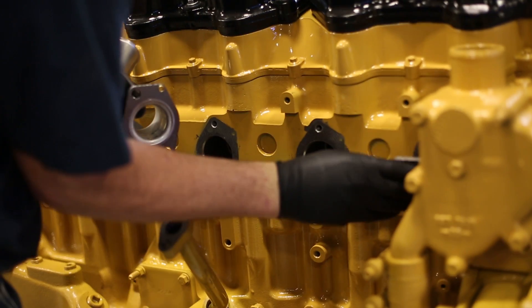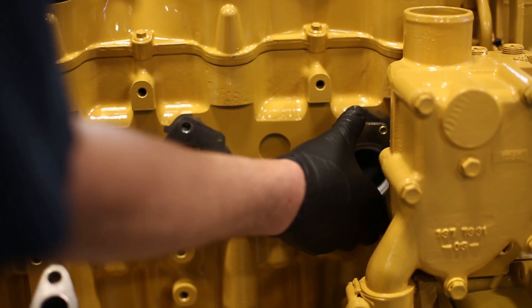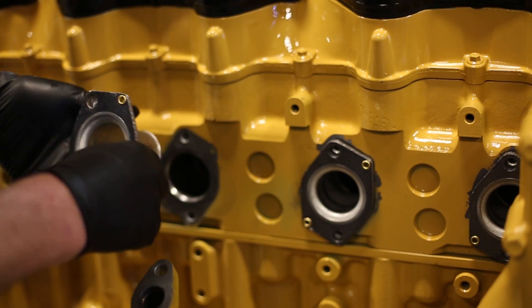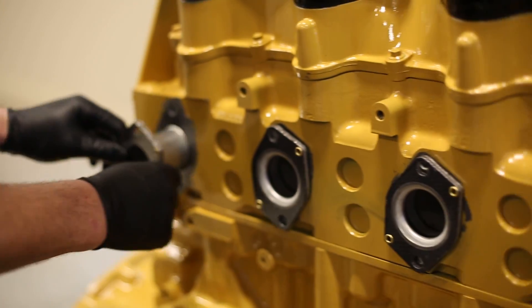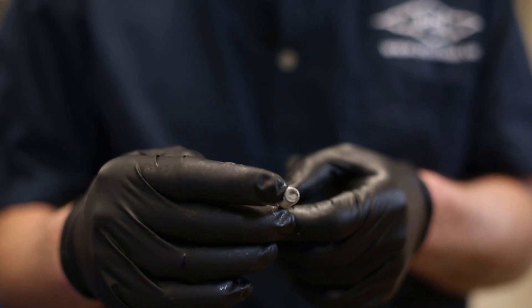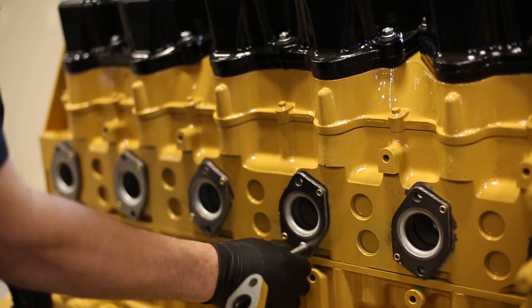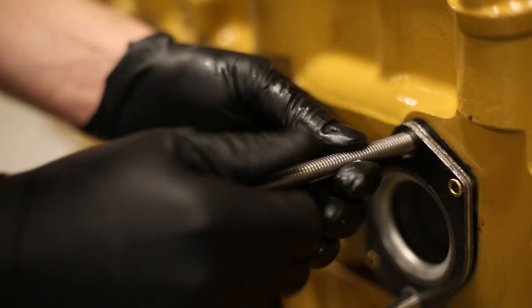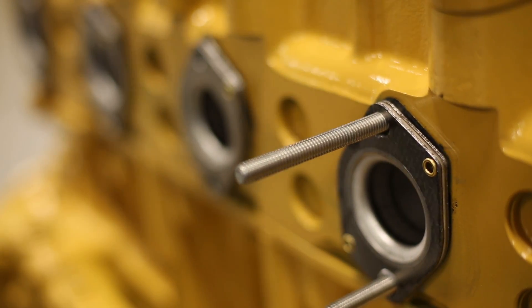This first sleeve gasket is just a little tricky — you've got to get it past the exhaust and past the thermostat housing, so just tip it in and line it up. These next ones are easy. We're going to put the tapered end in. I always put some anti-seize on each end of the stud — that allows them not to get all rusted up, so if you ever need to remove them, they're not rusted. Thread it in until it goes tight.